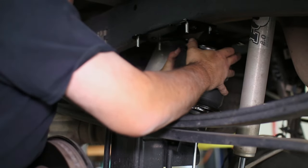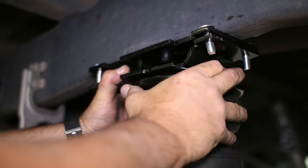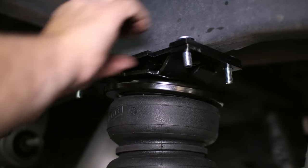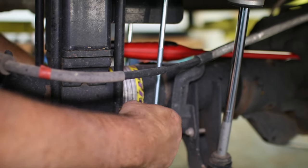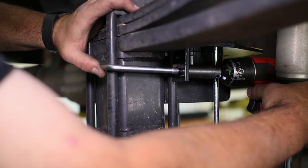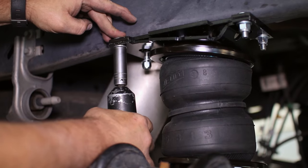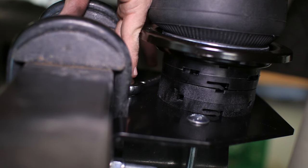Compress the airbag to slide its top plate through the four bolts in the frame plate. Here you can see the completed airbag system assembled on the rear end. The only step remaining is to secure the airbag to the axle by bolting it to the frame, slipping on the axle clamp, and securing the U-bolt to the side of the rear block. The rear block plate we loosely left bolted together earlier can now be tightened down completely.